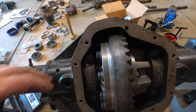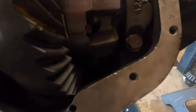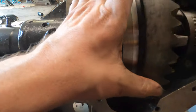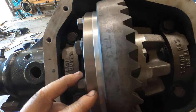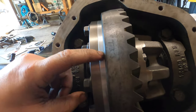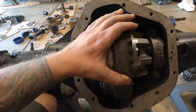Here's a look at the differential all installed. The ring gear is super close up there — it's kind of hard to tell because of the shadow, but you can see some of the remnants of the scrapes from putting it in. It's a really tight fit, and once you get it seated it gets all the room. We finally have it set — it took about four or five tries to get the shim spacing on the carrier right. Even with the spacer, we had to put a ton of shims on one side and a really small one on the other to get the whole thing moved over a little bit more to make it work.